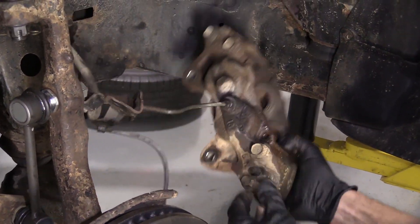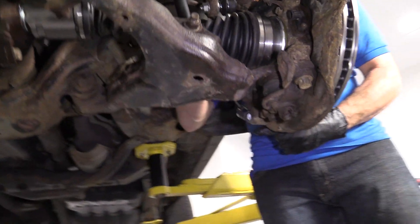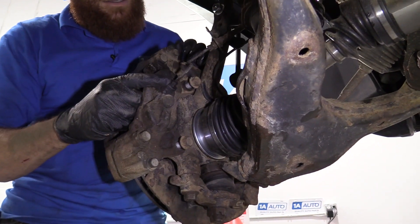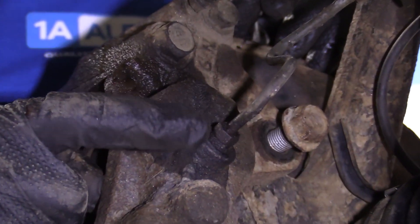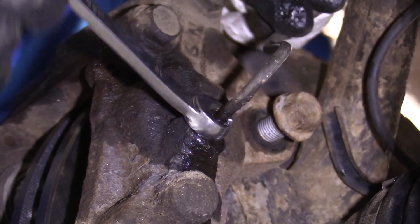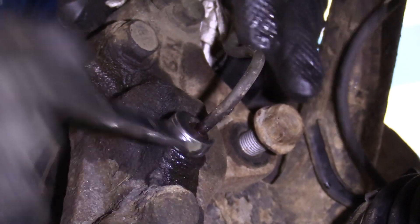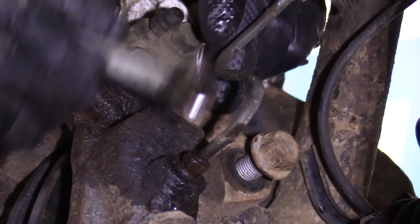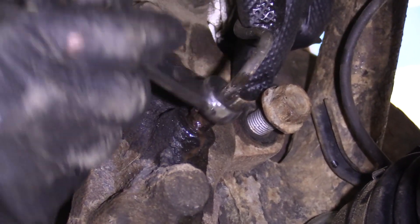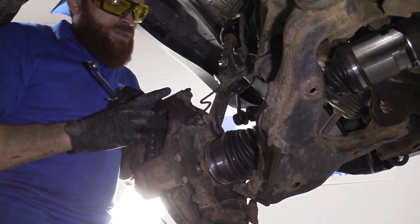Let's get our caliper and bring it back over to where we got it from. What I'm going to do now is start in these bolts. Now I'm going to try to loosen up this line — it's a good idea to spray it down with some penetrant. That's a 10 millimeter — safety glasses, of course. Sometimes the line might want to spin with it, so just take your time and try to break it free. You don't want the line twisting — you can twist the line and break it or crimp it, and both of those would be very bad.